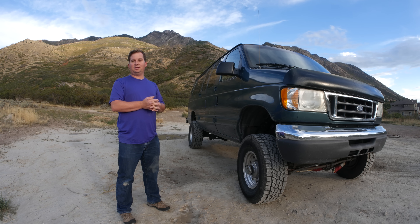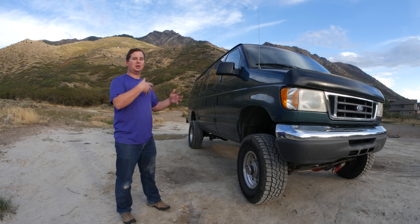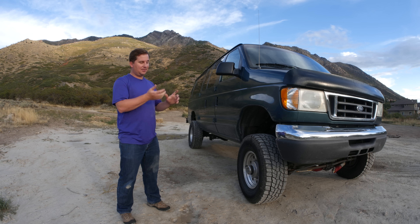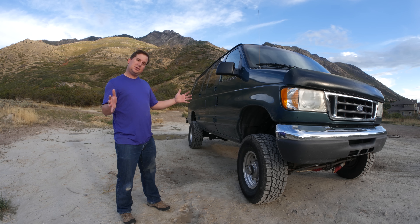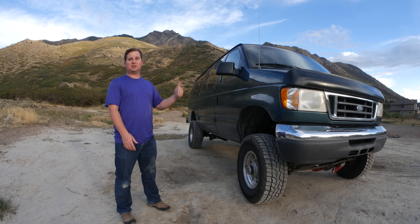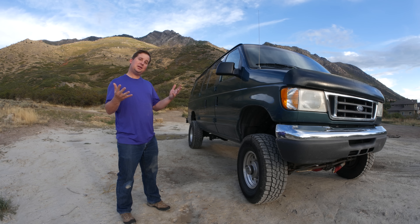For wheels, we're going to go with a 17-inch wheel on a 35-inch tire. I would love 37s for looks alone, but my friends who know a lot more about towing convinced me to stick with 35s — it'll tow better, get a little better mileage, and put less wear and tear on the drivetrain. Moving up to 35s, I'm going to want to change the axle gear ratio from 3.73s to 4.10s. And since the new front axle has a new bolt pattern, I have two options in the rear. Rather than wheel spacers, I'm going to source a 10.5-inch Sterling out of an '05–'07 F350, which is a little bit wider. Chris has a kit to make the e-brake work with it, so I won't have to run wheel spacers. That takes care of the suspension department.